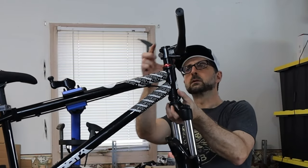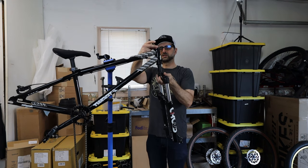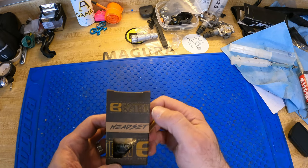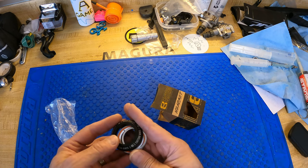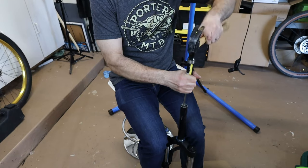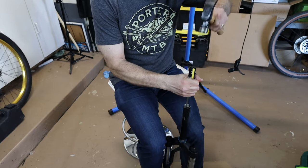The typical straight steer mountain bike headset bearings are 44 millimeters. Turns out that this bike takes a Campagnolo style headset, also known as a Campi. For good measure, I decided to punch out the Starnut and install a new one. It turns out the Starnut was a bigger pain than I expected.